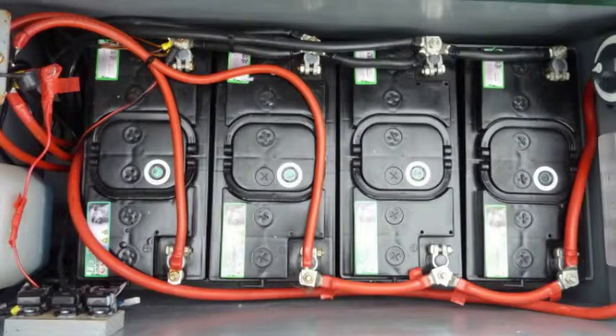So when we have a battery, the best bang for the buck and the most longevity without excessively babying it, is to figure out the boat's amp hour consumption over a 24-hour period if you're cruising, and then say, that's how many amp hours I need — I need at least triple that. That's for short-term cruising. For long-term cruising, you need a battery bank measured in amp hours probably four times your daily amp hour consumption.